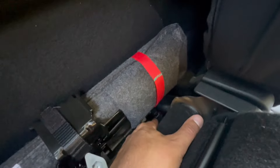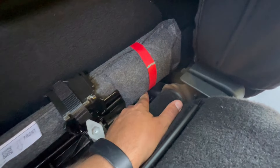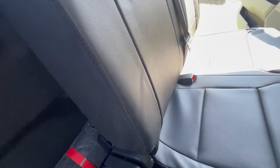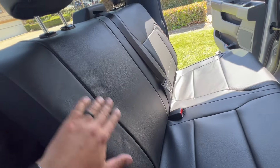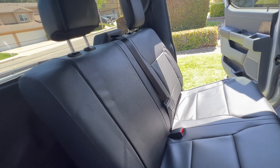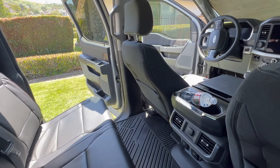There's an assortment of electronics — they're all for your seatbelts. There's two plugs down here; just press the tab on the back and they pull right out. The wires have a little retainer clipped onto the metal bracket that you can just pull right off. Take those bolts out and they should lift right out — these are relatively light, they're not powered. I've got a few wrinkles I need to get the heat gun on, but otherwise it looks pretty good. This one's a little heavy, the other one's very light — take them to a workbench.